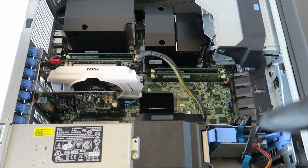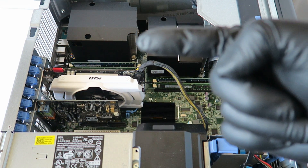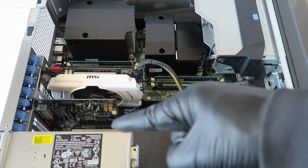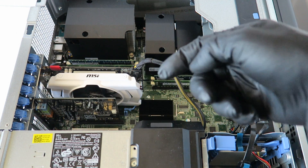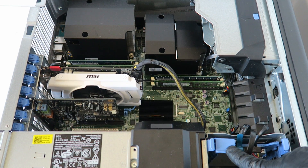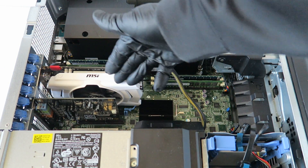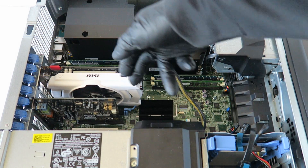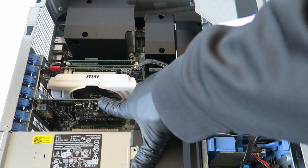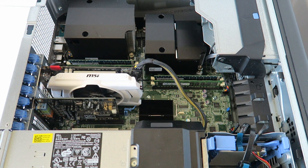So we upgraded from hard drive to solid state drive, upgraded the memory from 8 gigs to 16 gigs, upgraded the video card to a GTX 950, and upgraded the sound card to the XFI Xtreme. When you turn on the computer, plug the monitor directly into the video card and install your Windows operating system. Go to nvidia.com for the latest GPU drivers, and get the sound card drivers from the manufacturer's website as well. It's a nice workstation for gaming.